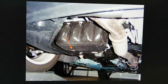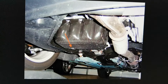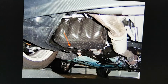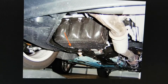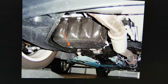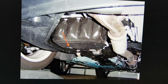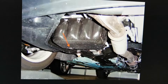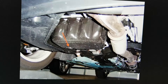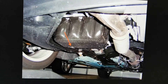At this stage I want to come clean and let you know that we actually removed the wrong plug — the wrong sump plug. We ended up removing the sump plug for the transmission fluid instead, so please don't make the same mistake that we did. The correct sump plug is on the left-hand side of the engine, right underneath the engine — it should be pretty obvious. We were going to change the transmission fluid anyway, but yeah, don't make that same mistake.